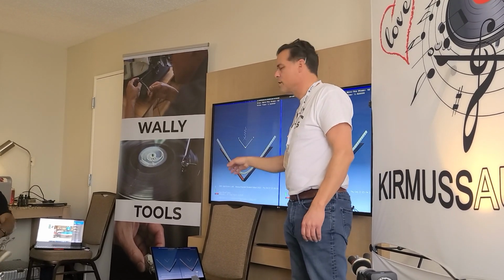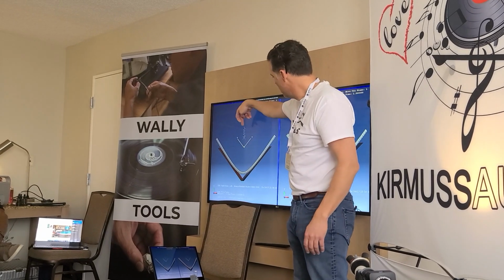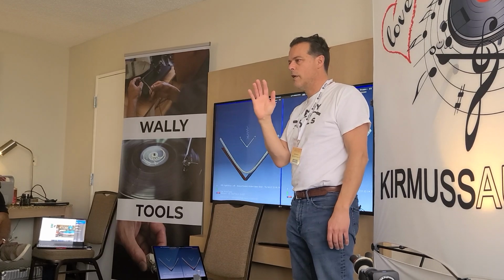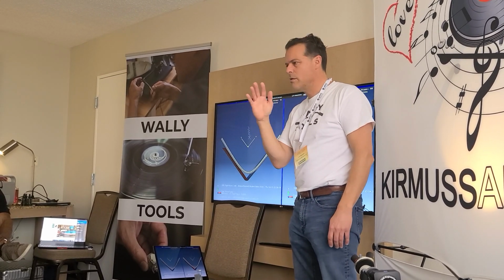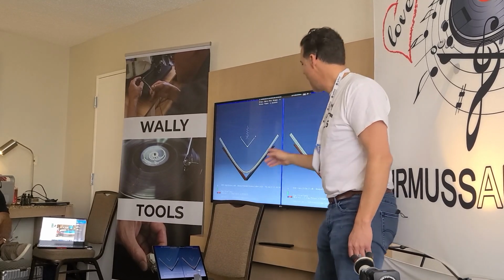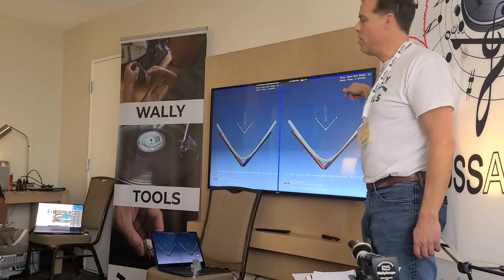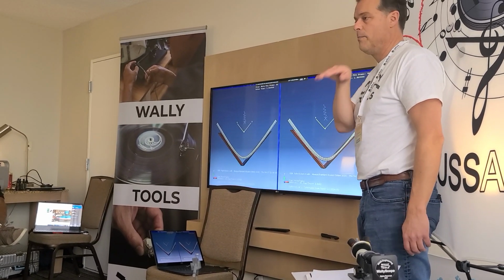And we have the stylus perfectly oriented in the groove. And you just look at the spring, that's very helpful. It's just going left, right, at different frequencies. So there's actually two frequencies in that groove. Now if you introduce zenith error, now you see the vertical component. Look at the spring, really shows it. It's going in an ovular pattern.